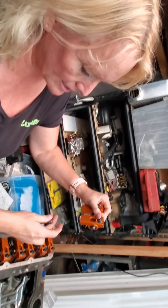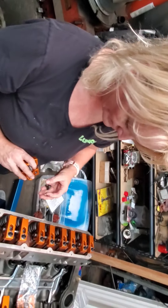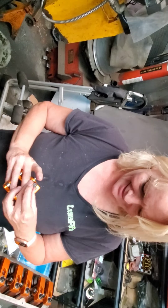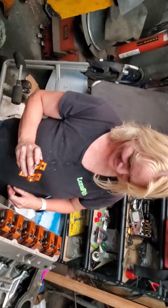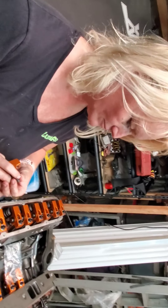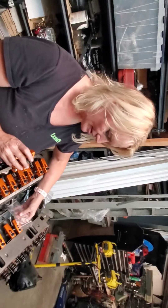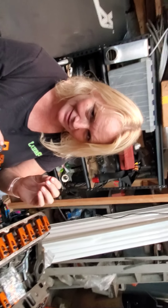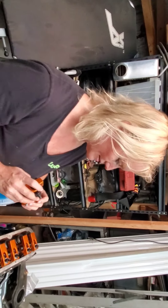You can see through these that there are little bolts right through here, and then there are these pedestals. This goes over here just like that. What we're using is these spacers — they're 60 thousandths each, so two of them makes 120 thousandths.